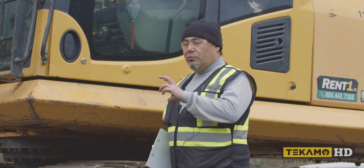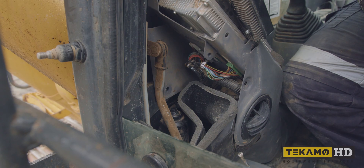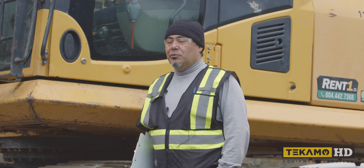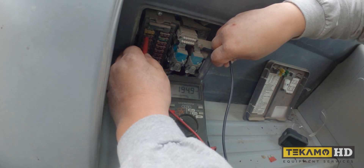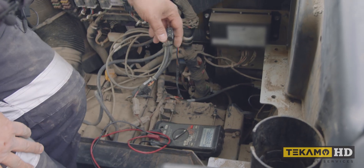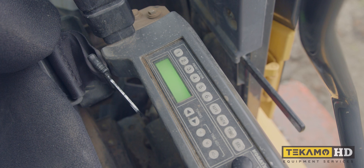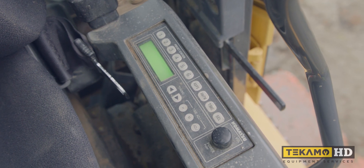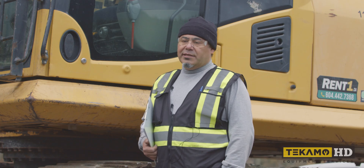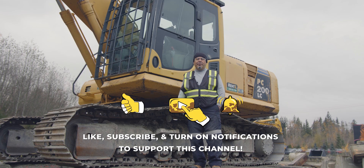For the wiper motor, we cleared the fault code — it could have been moisture in the connections, but we'll monitor it and make sure it doesn't come back. The wiper blade needs to be replaced and we'll get that on order. For the heater motor, we tested the fuses, checked the relay by listening for the click, and checked the voltage at the motor — we do have power and ground there, indicating the motor needs to be replaced. For the radio, we checked for power — it does have power but the digital display is not reading and the controls are not functioning, telling us the radio has an internal issue and we'll put that on order as well. To support the channel, like, comment, and subscribe.